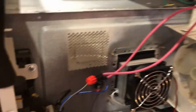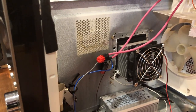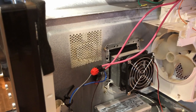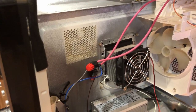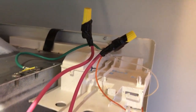At first I tried to have the built-in timer work, but the problem I ran into was that it wouldn't run unless it got a pulse width modulated signal from the magnetron's inverter, and that would be way too much work to duplicate that signal and trick it into working. So I cut all the wires off and hardwired everything to the main power coming in.